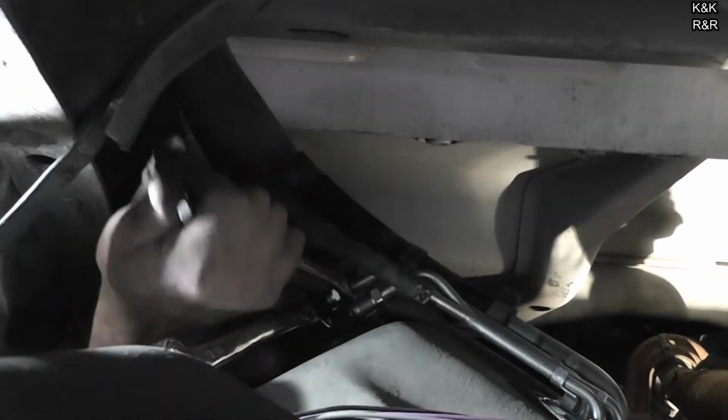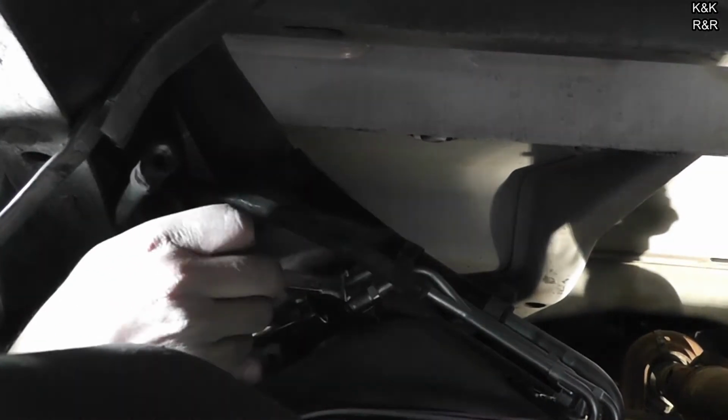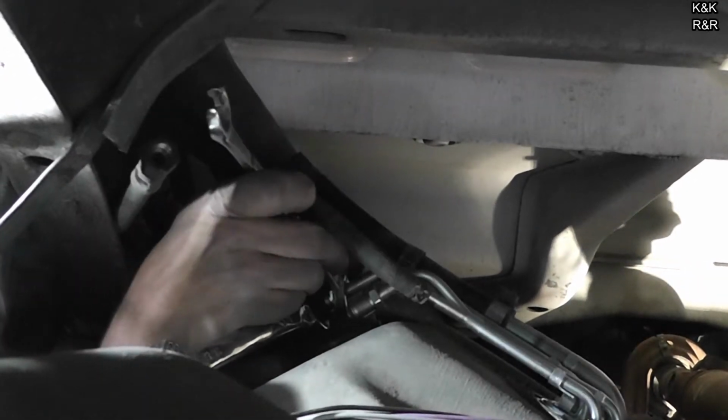And we will test this tank before we put it up. The thing with setting O-rings, they can give you a false sense of being torqued when they're not. Better for it to be a little too loose and give it a turn than be too tight.